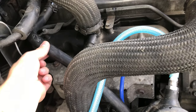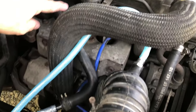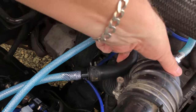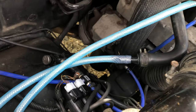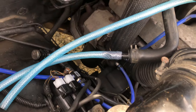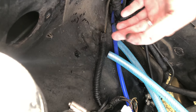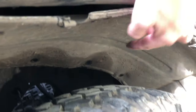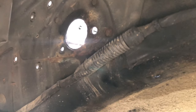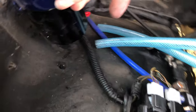I'm going to temporarily continue using the original tube that comes from the valve cover. I'm going to zip tie this here temporarily — slash permanently — I don't know; depends on how long these tubes last. I just want to see what kind of stuff comes through them, how dirty they get, and how fast they get dirty. There's sort of an indentation that kind of serves to make a little space for the valve on the bottom of the can. I'm going to mount it here, which means I had to pull the plastic fender well cover off from underneath to access it. It's low enough so the air filter won't hit the hood, and there's enough space underneath.